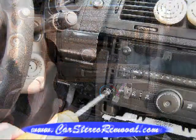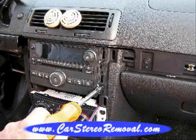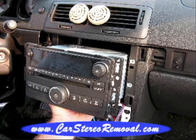We're going to remove two mounting screws to the left side of the car stereo, two mounting screws to the right side of the car stereo, and pull the car stereo out of the dash. This is a VIN-locked stereo. Any replacement will need a coding through the dealership.